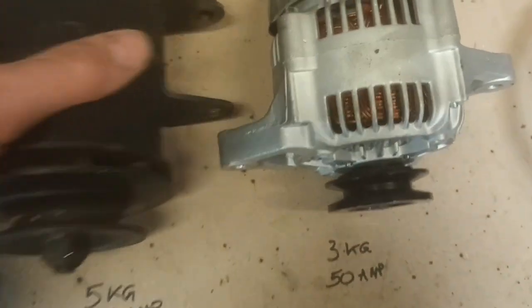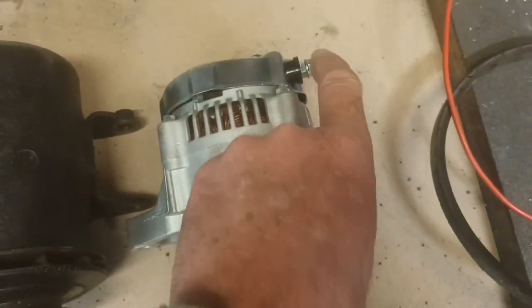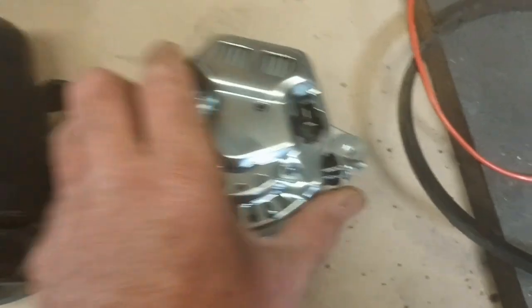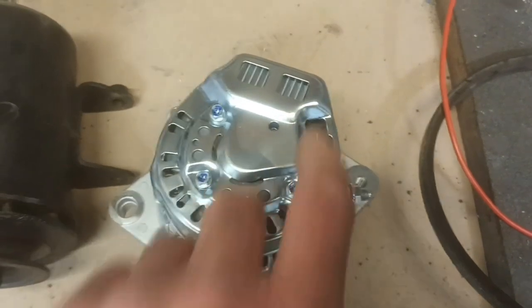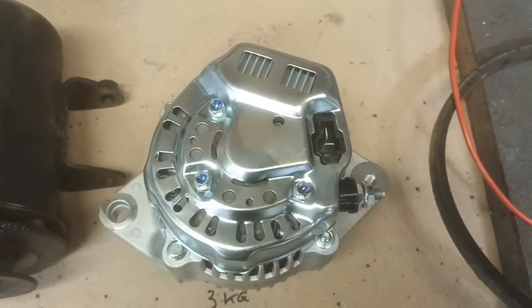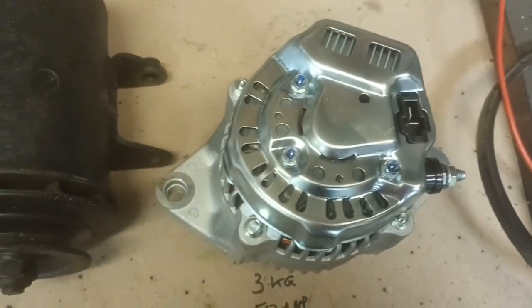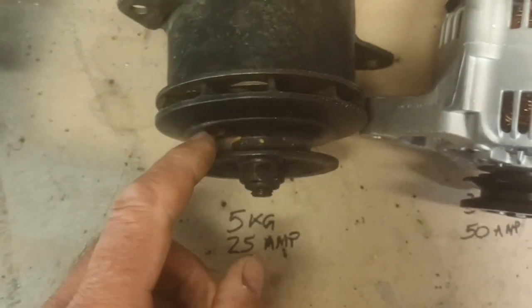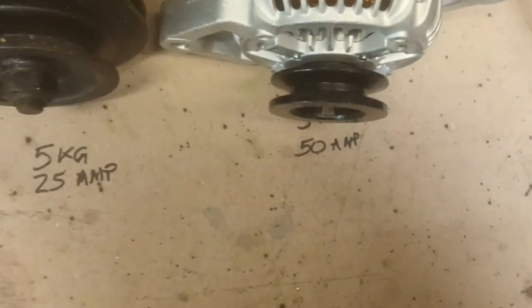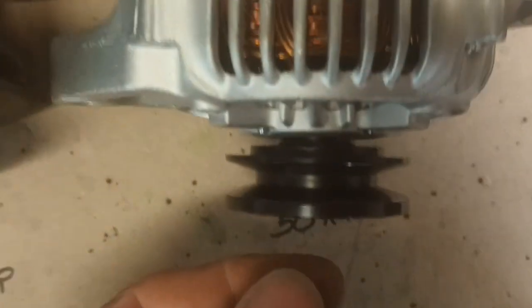Things are pretty similar - the distance between that lug and that lug are identical, and this relies on one mounting lug rather than two, which I can sort out. For wiring, this is the main feed for the battery. Here we've got two connections: one is to the lamp and the other needs a 12 volt ignition live. So this will be the new black wire from the oil pressure switch. These take a 12 or 13 mil belt; this is designed for a 10 mil, and I can buy a pulley with a 13 mil groove in it.